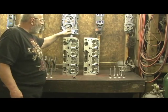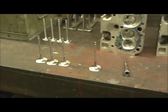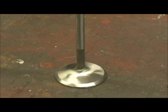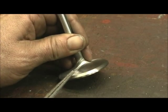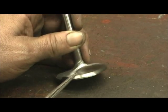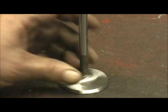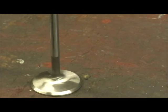I want to talk about the valves for a minute. These are SI's top-of-the-line 205-160 valves, and one of the ways that you can tell — I don't know if the video will show it — but on their top-of-the-line valves, it'll always have a 30-degree back cut on it along with the 45-degree seat. I've used a lot of valves from different manufacturers, but SI is definitely one of the ones up there at the top. Let's slide them in here and see what it looks like inside the combustion chamber.